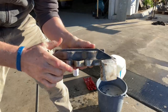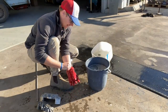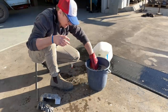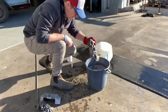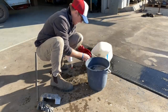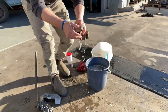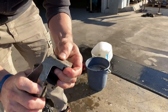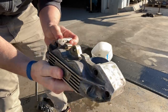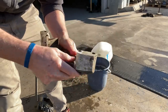At 20 minutes it's really aggressively bubbling away, really starting to eat into that aluminium. We're only taking thousands off at a time but this should be pretty close now. We get it in the water to stop the reaction. All that anodizing is just real slimy now — we can rub it all off, give it a nice cleanup, and it'll be a raw aluminium finish ready for further detail work.